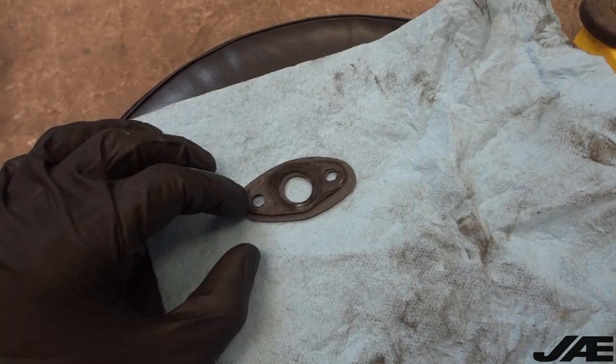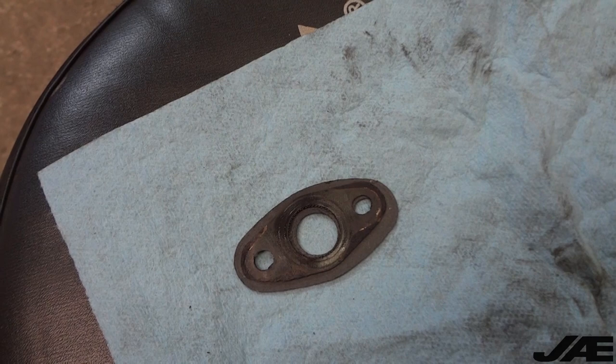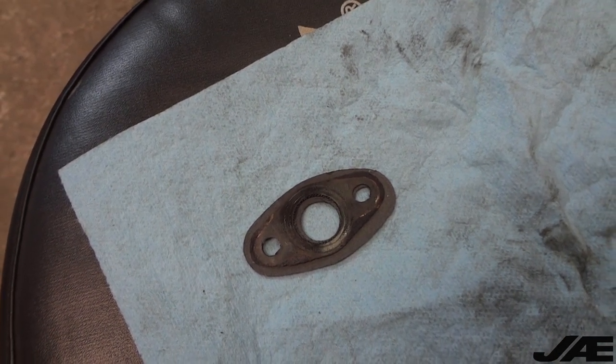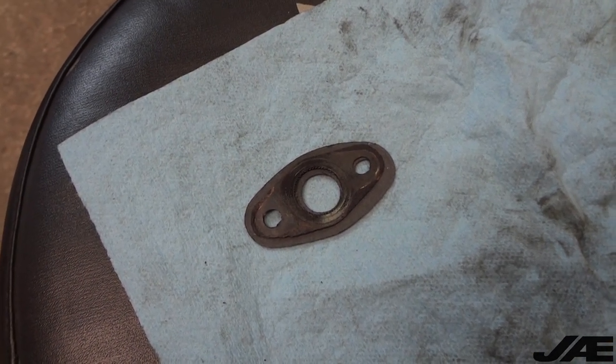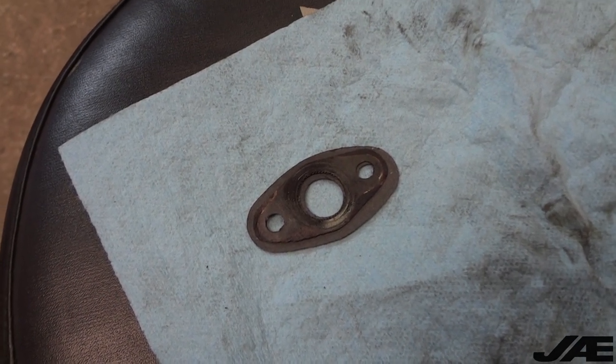If you overlay the gaskets, you can see that the one supplied by 034 actually has a smaller opening and a larger overall diameter. So that gasket's actually hitting the turbo and I can't install it correctly. And I don't like how the gasket material is hanging over into the oil drain area. So I'll go pick up some OEM ones that should fit a lot better.